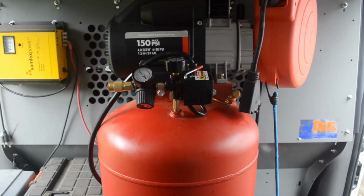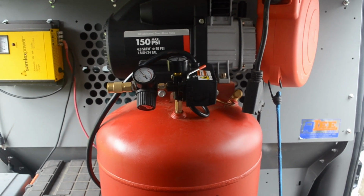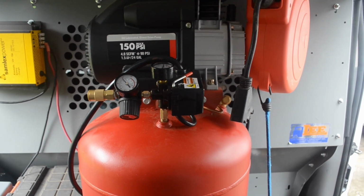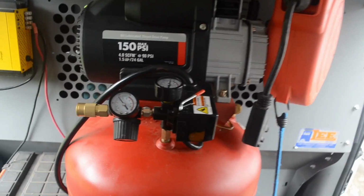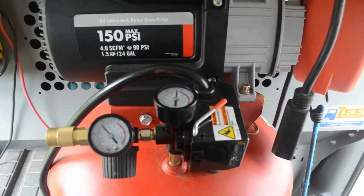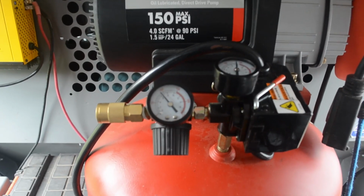Now here's a question we might hear at the seminar. What air pressure do you use? And we recently got this question on the channel as well, so let's just take a minute. Of course, for every compressor, you're going to have a couple of different gauges. One will be the tank pressure, and one will be your line pressure. And the line pressure here is about 90 pounds.